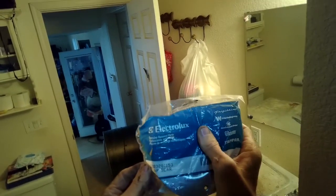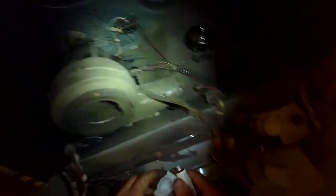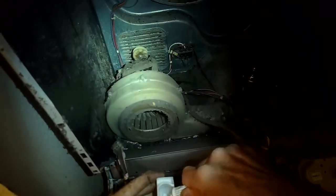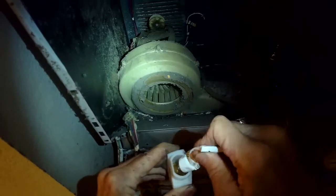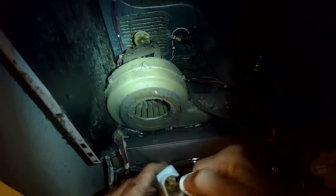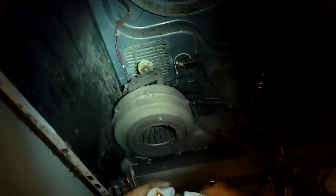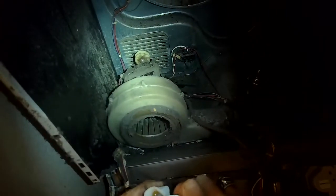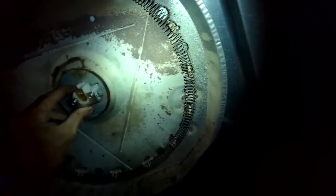It's a really nice kit. It comes with this high temperature grease — we're going to squeeze a bunch of it like toothpaste into this plastic cup. That metal ball behind the tumbler rests into this cup, so that lubrication and grease really helps to make it spin smoothly and it lasts a long time. The kit also comes with a new metal piece that holds that plastic piece against the back, and a little BB. I added the BB behind that plastic piece.